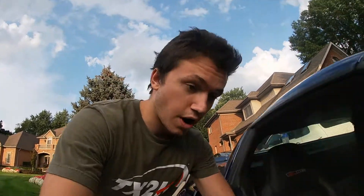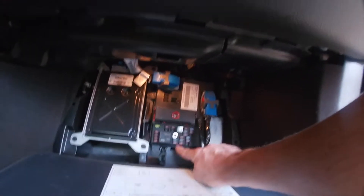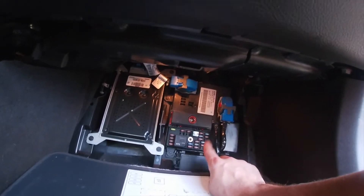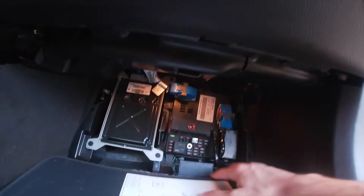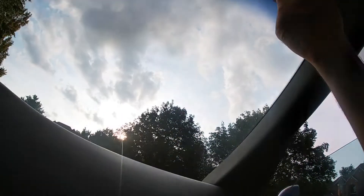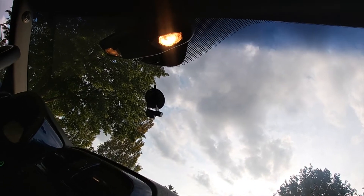It's going to stay inside the cabin, which is very nice — we don't have to go through the firewall or anything. Obviously whatever you're doing to your car it might be a little bit different, so take that into account. But for ours, if you just pull this down, there's the passenger footwell fuse box. We're going to tap into whichever fuse has power only when the car turns on — we don't want one that has power all the time because that could drain our battery. Once this is hooked up, we'll run the line through the pillar and tuck it under.